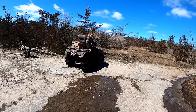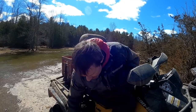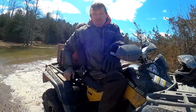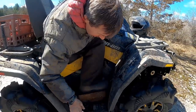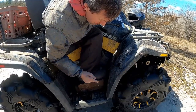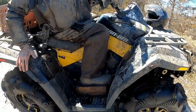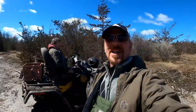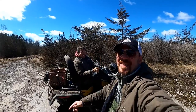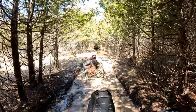30-inch Sledgehammers are working well. For those on old gen ones who can't fit 30s — wherever we got it, we put 30s on and cut and did a bunch of stuff. Whenever I put these on, one side was closer than the other. All you do is take a strap — there are two aluminum hoops in the framework underneath. Take a three-quarter-inch come-along from the front bumper to the hoop and another from there to the tire, then pull the hoops ahead to shift things out a little bit. You might even squeeze 31s on there. Beautiful day, saves carbon — right on boys!